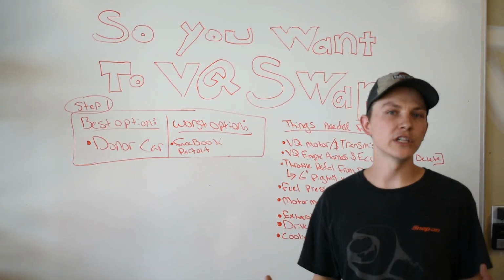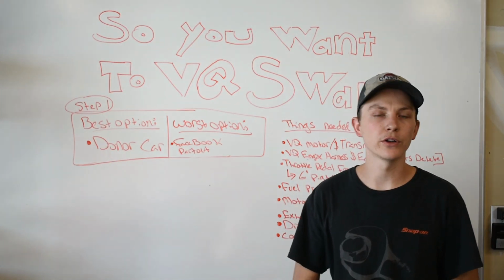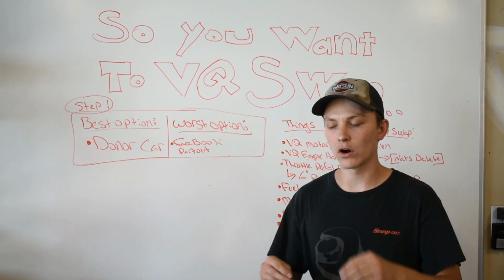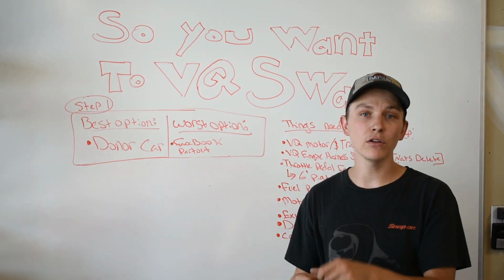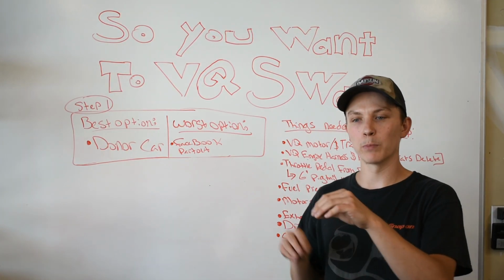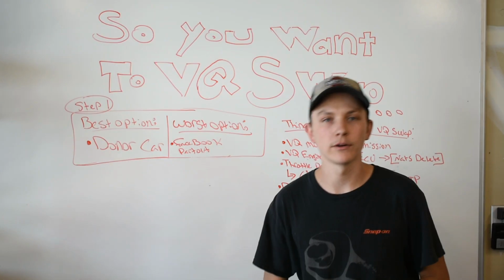So you'll need to do a lot of custom cooling system modifications to your car in order to accept the VQ. From the factory, the VQ gets air pockets in the cooling system, so there are T-bleeder valves on the actual heater hoses, and in other various locations on the motor. So when I did my VQ swaps, I made sure to put bleeders in certain locations, and I'll show you when we swap over to my car.